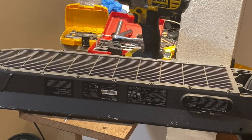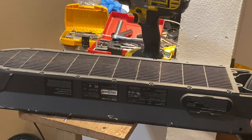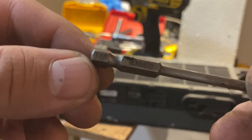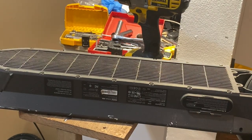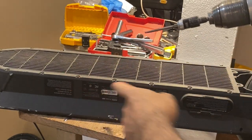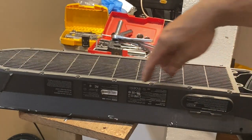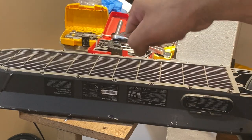In this step I'm going to be removing all the screws around the battery cover. For that I'm going to need Torx number 15 — it's a very worn one already, but it's a Torx head number 15 and it's a security lock. When removing the screws you can use your screw gun, but when putting them back in, use your regular pin screwdriver.